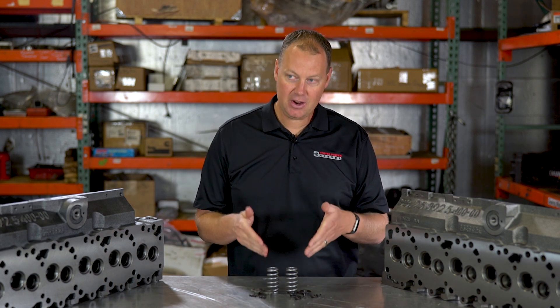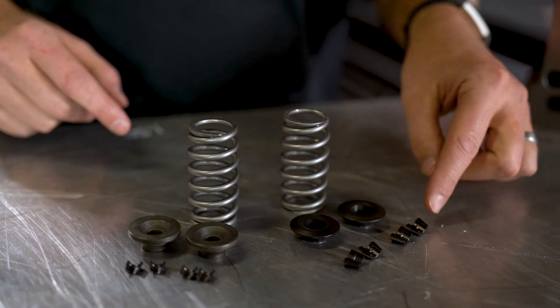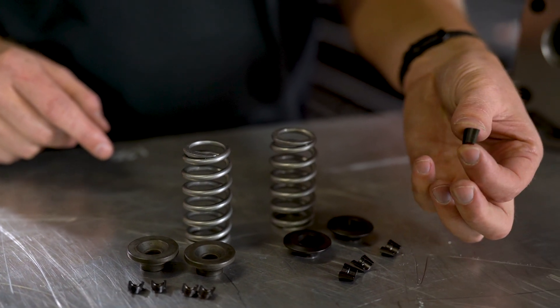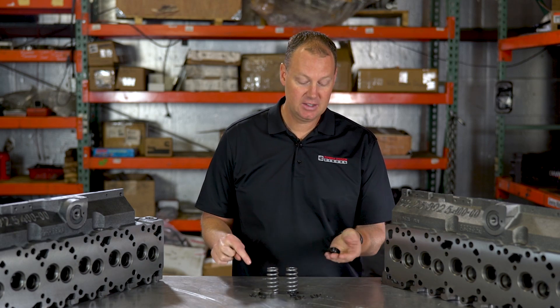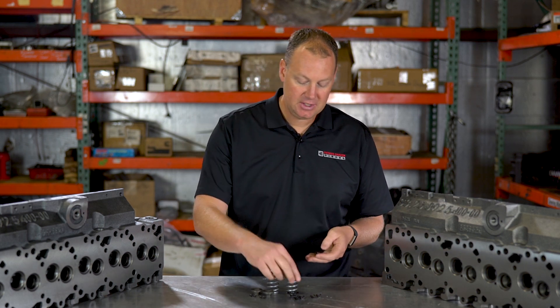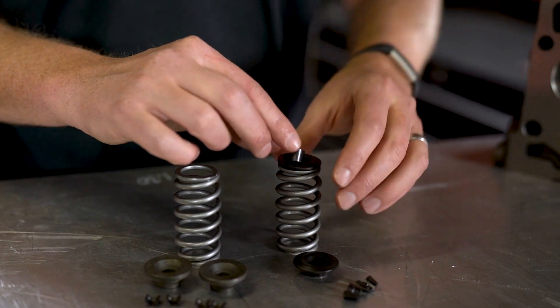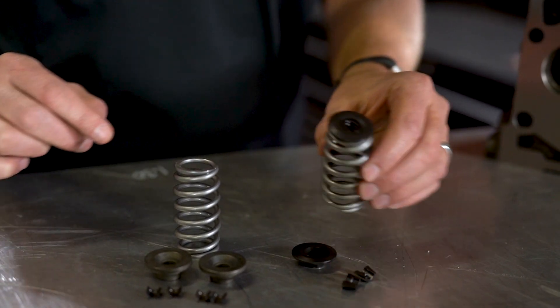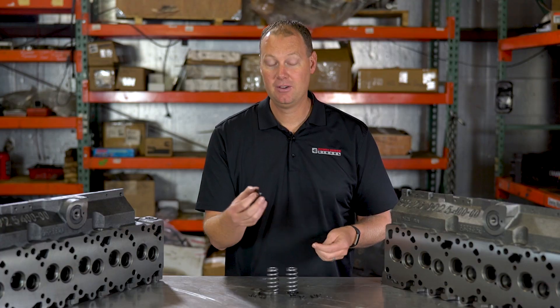It did bother us that there was a very capable spring that's good for guys up to 700–750 horsepower, but you're better off with a much better spring. So we designed our own set of retainers and locks. This is actually tool steel — not as light as the titanium stuff, but way cheaper and much lighter than the stock stuff. The stock hardware weighs about 40 grams for a set; ours comes in at about 30 grams and is way strong. In addition to the tool steel material, we use a 10-degree lock, which is a much steeper angle compared to the 7-degree locks on the factory hardware. So in addition to being stronger, it's actually harder to pull through because of the angles — it's a way stronger, much better upgrade for your valve springs.